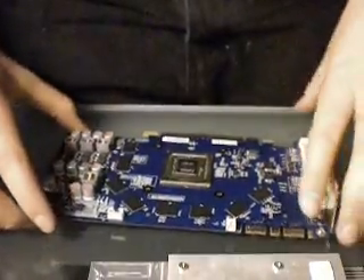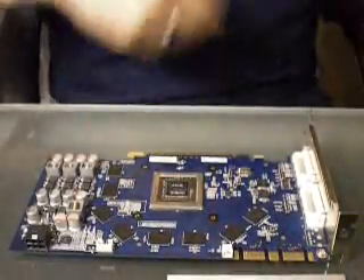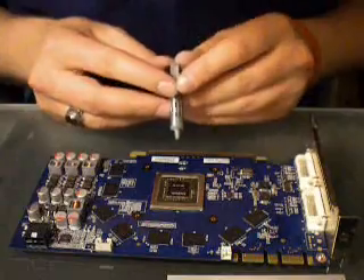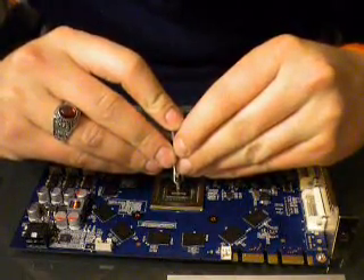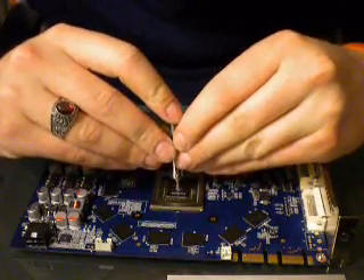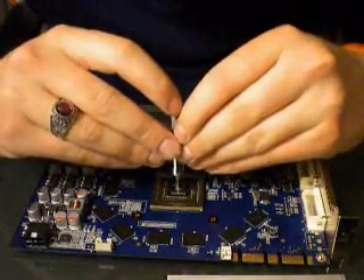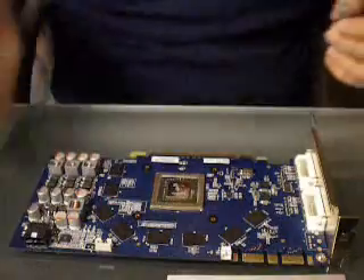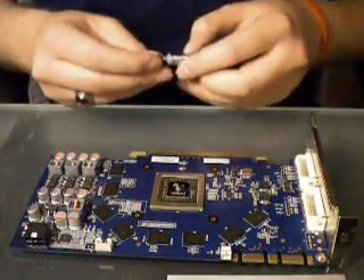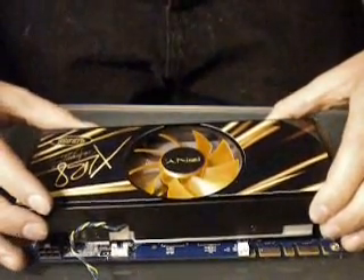Here's the graphics chip and board — nice and shiny and clean. Then go ahead and take your thermal compound. You can pick any brand you like. I am using Arctic Silver 5, and I use the dot or pea application method. I think it covers more space on your graphics chip and seems to spread more evenly. There are a bunch of different other ways you can look up, but this is the one that I prefer.